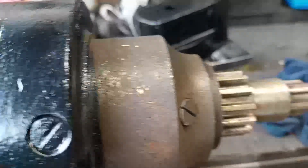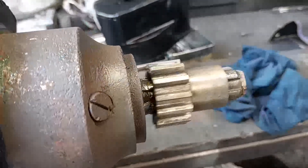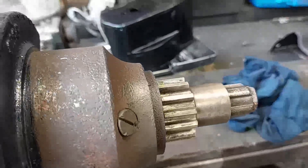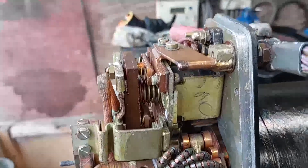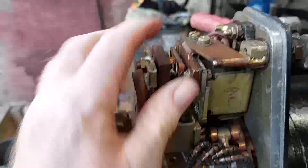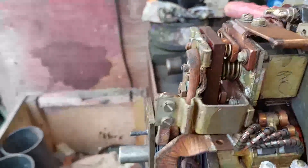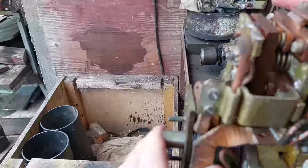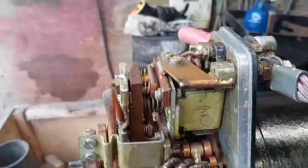It simply pulls in that bar and only that bar. The bar is connected up through the hollow in the shaft — you can see the splines there. So only the pinion moves forward as described. You've again got a switching mechanism here which pulls on the full current as that bar moves forward. It's all very simple.